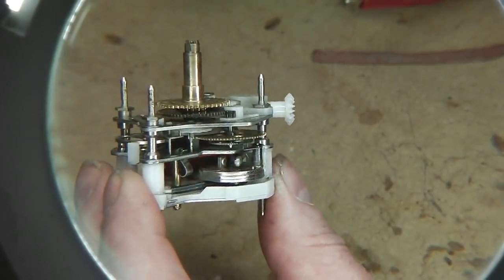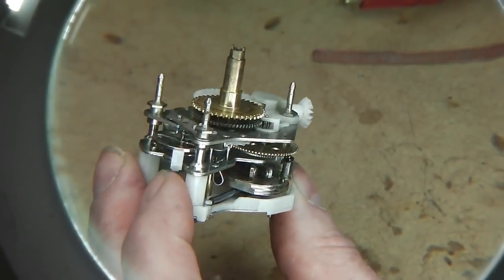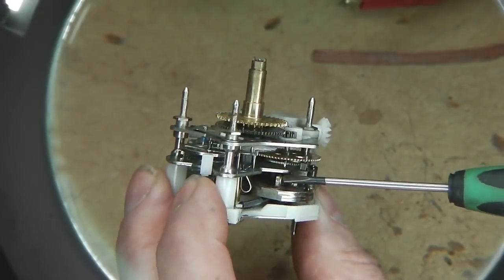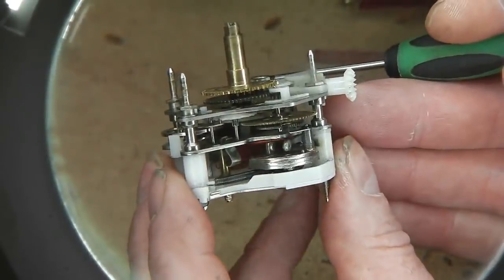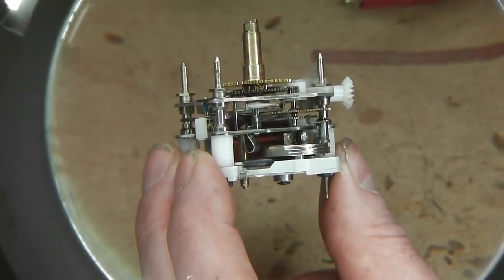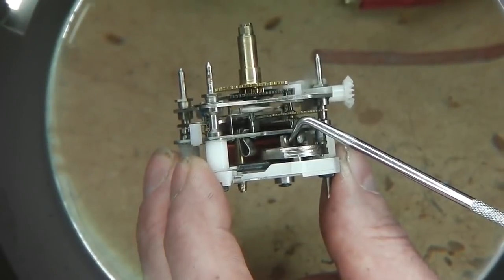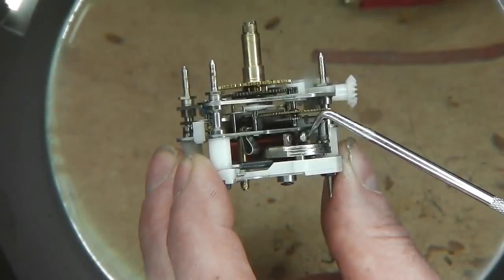Yes, you could, if you could really get into it, you could take them apart, but it looks like one set of contacts is actually built into this flywheel here. So if that pad, can you just see that pad there? I'm hoping you're focused enough. You need keen eyes, but let's use the pick because it's got an angle on it. Okay, end of the pick's touching one contact face. That's on the flywheel. And the other side's the armature of the solenoid.